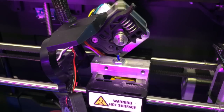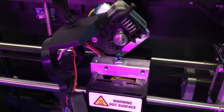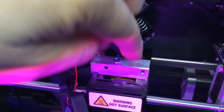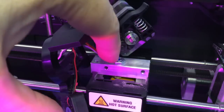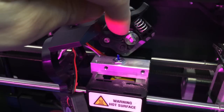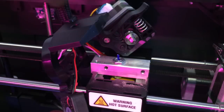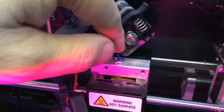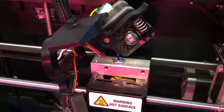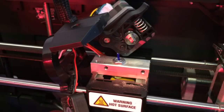Once it's hot enough, I'll be able to pull the filament out. This is the boring bit. Last time, when I ran out of filament, the filament goes through this filament feeder here and through here. Now, this is a cold block at the top — there's a fan on this — and underneath there's the hot end. Normally this doesn't get too hot. What had happened is the machine had run for an hour with just this little bit of broken filament in it, and the result is this got hot enough that it created a plug in here. This was wide enough that you couldn't pull it up or down, you couldn't push it through. Heating the head didn't help because it didn't heat this enough to melt that plug, so I couldn't force filament through — I had to dismantle it, and that became a little plug. This time we've actually got filament in there, which is odd that I can't force it through. I'd expect to have been able to push this through from the top, so maybe I didn't need to dismantle it. But you get the idea — on this occasion I have tried that and it didn't work.